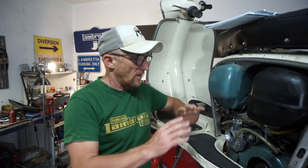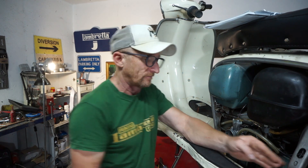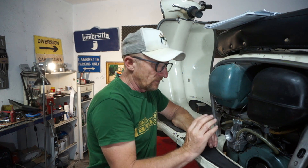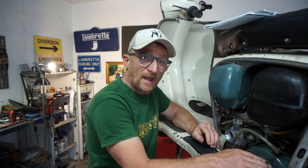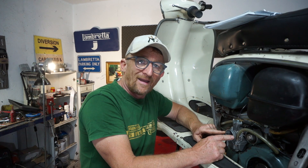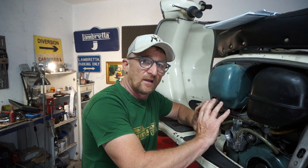So what we're going to do is design an air box that fits inside here, taking its air from the back so it gets cool air coming up from behind the engine — not up through the top like the original. We're doing away with that and designing a whole new air filter that fits in here. It's going to enhance airflow into the flywheel for better cooling, better flow into the carburettor, better filtering, and the whole thing is going to fit in here nice and neat, all done on a 3D printer.